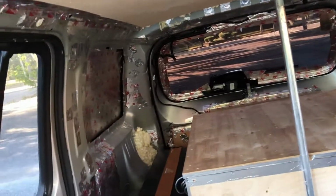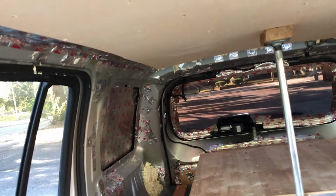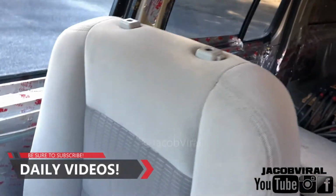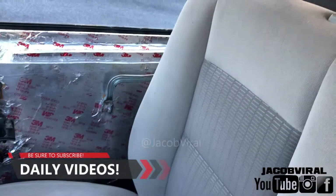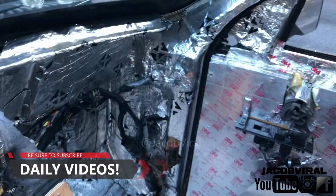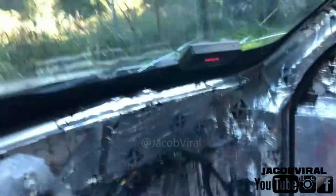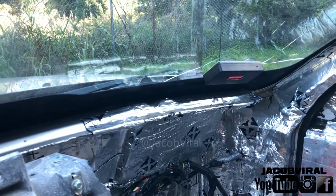So a single 12 SP4 Plus series, dual 1, wired down to 0.5, 0.6 ohm. We'll figure out the rise on another video. I don't really know, and I don't want to say something that's incorrect. Let me get this on the glass like I always meter. Find out my peak, it could have changed since that block of wood I put in.